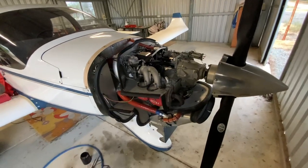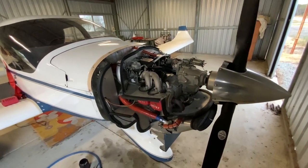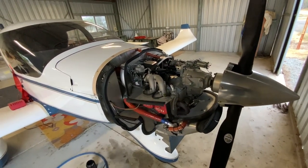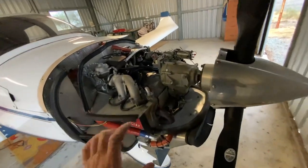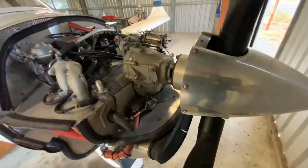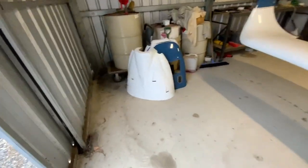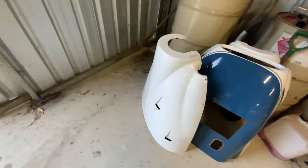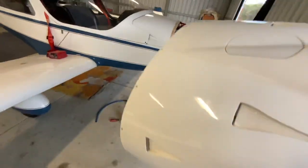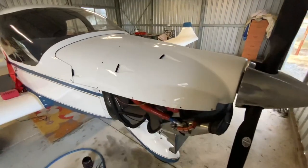There are a lot of baffles on this engine — by baffles I mean these things here, which are designed to direct airflow. With Rotax engines, especially in a forward installation, they're typically not needed or they just add too much complexity. In this case the cowling intake for cooling is down here, so all the cooling air is basically hitting these baffles and going straight down. There are a couple of little ducts on top but those are actually the wrong type — a lot of people think those are NACA ducts.